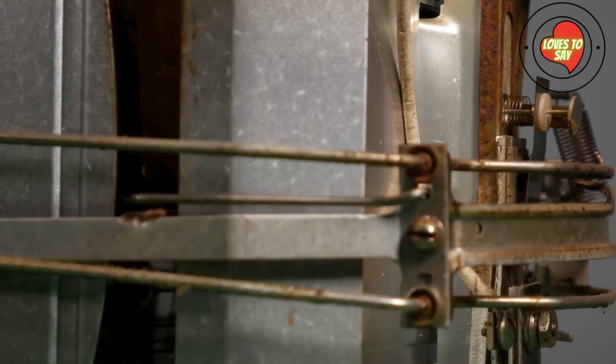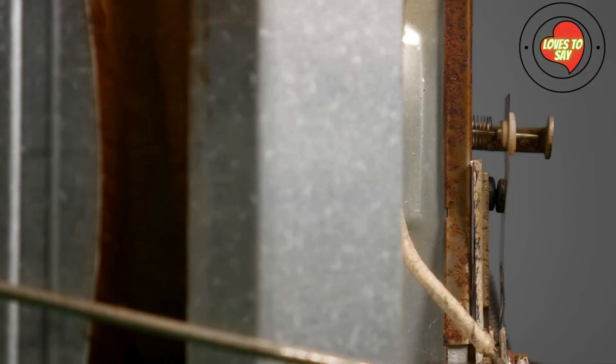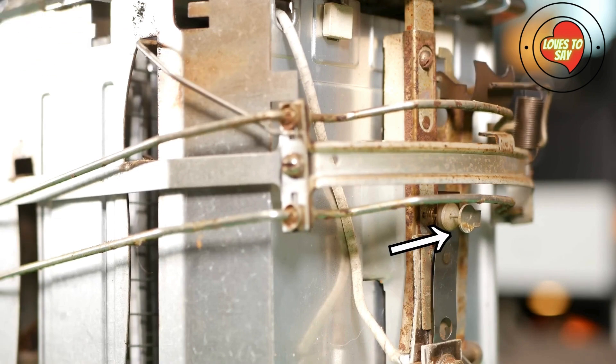The darkness control simply moves a little peg that presses on the bimetallic strip. And what releases it, of course, is the action of the bimetallic strip. This little helper pushes on the bimetallic strip inside the toaster. The force of the bread falling on the trip lever flexes the bimetallic strip via this linkage.